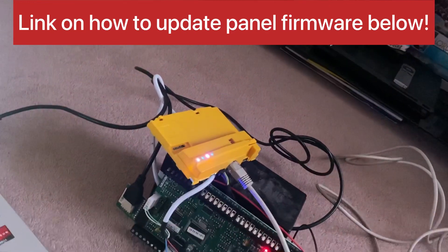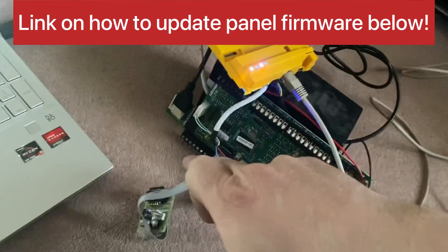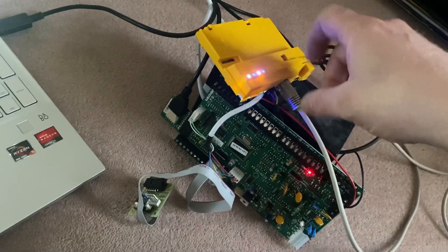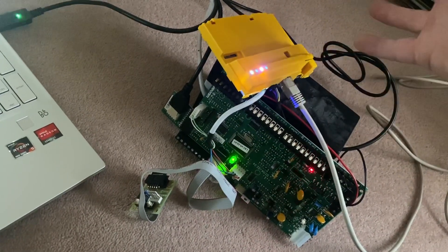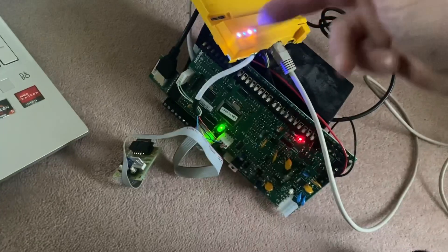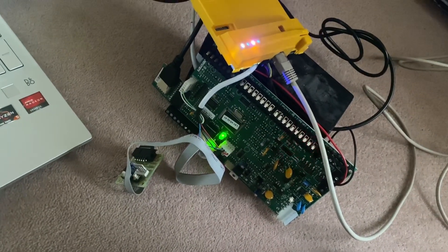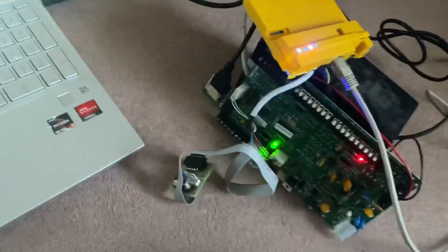It's now doing a firmware update, but before I did that I connected the flash drive and flashed the firmware on the panel from version 5 to version 6, because version 5 seems to be a problem child recently. I defaulted the panel by pressing that button 20 times rapidly, and then connected the ethernet cable and fired up a firmware update via the cloud.